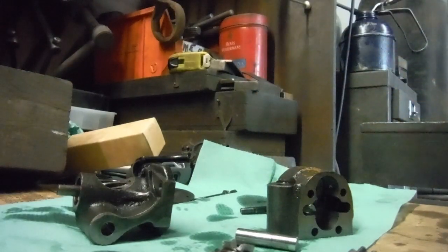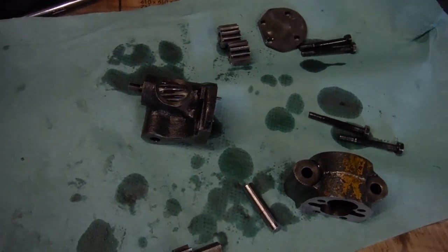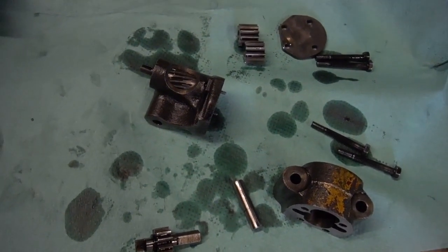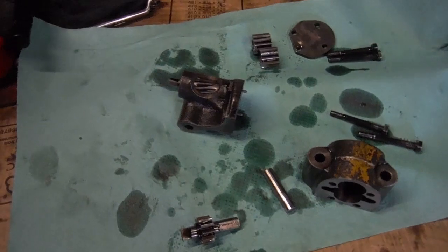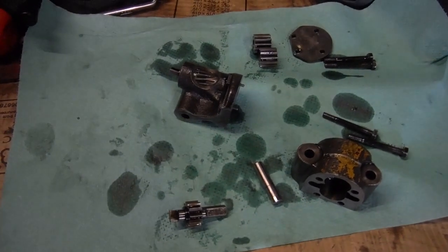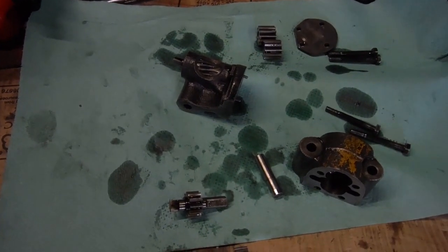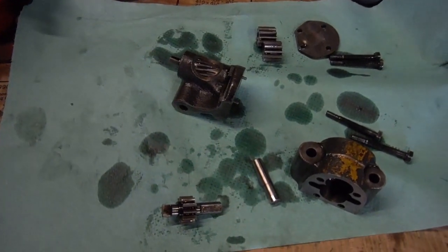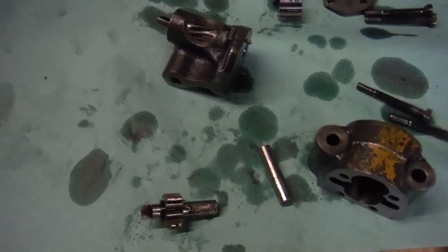I'll be recommending and probably fitting a new pump. As for the rest of the engine, big end shells aren't very expensive so I'll put a new set in anyway, even though the ones in there don't appear to have been there long — there is a little bit of scoring. I'll take the crank up to my crank expert and let him see whether it needs a polish; I doubt it'll need a re-grind. Before I put new shells in I'll let him look at it, get a new thrust shim for the timing side bush, and then I think it can all go back together. Fit a new oil pump and good oil pressure will be returned to this engine.